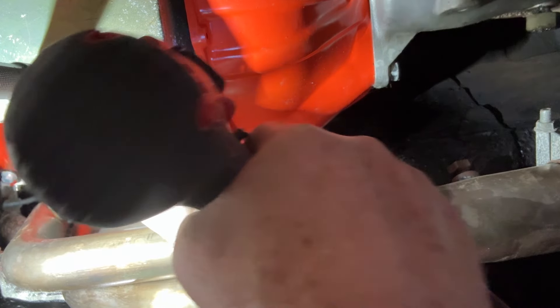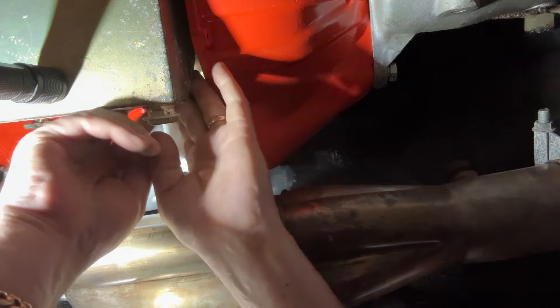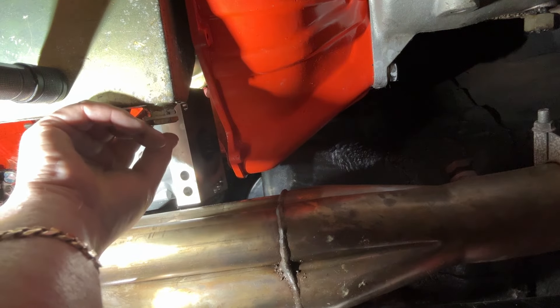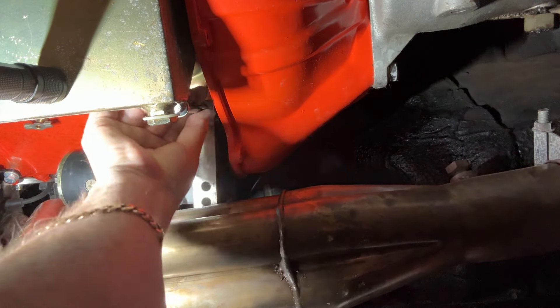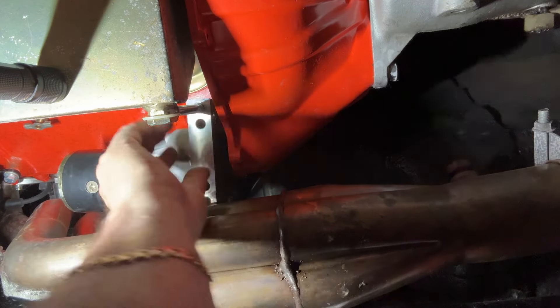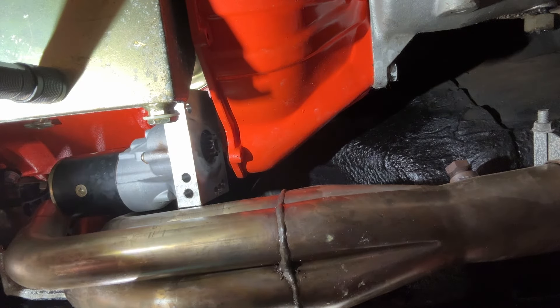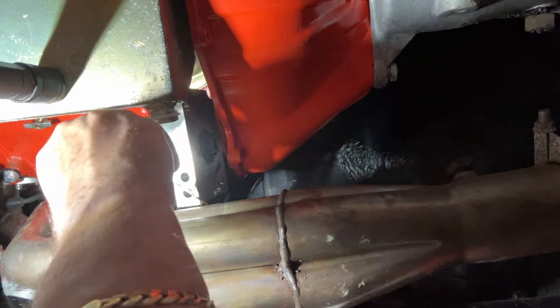Here it comes — hope it doesn't fall on my new phone. I put this starter in before I put the headers on. I think for right now, just for adding a shim, I'm glad that's the way I did it. Come on down. Getting the shim — I've got two shims for the starter, they are 18 thou each. I'm going to put one in because it was working and then having difficulty.